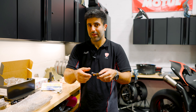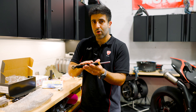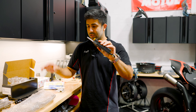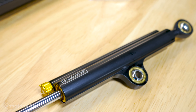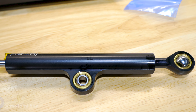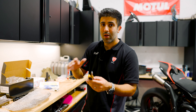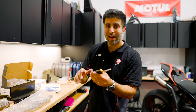It has quite a few — I think it's 32 or 36 clicks of adjustment — which makes it soft or hard. If you just received this and opened it like me, don't be alarmed. If you look closely, you'll see there's oil that's leaked around a little bit. Even with new forks, there's some spillage that happens in transport. Don't worry, this thing's not leaking — it's brand new. We'll wipe that off when we're done.